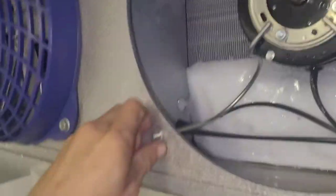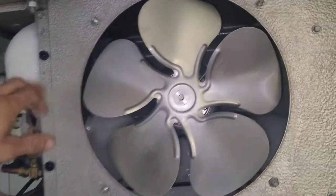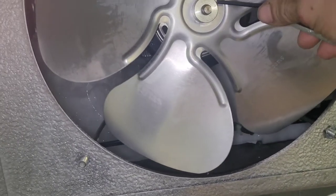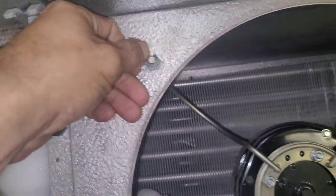To get this out, I'm gonna take the fan out so I can pull it out. I got this fan out — I was able to manipulate that one out, and the one over there out. But there's one back behind the one on the left that's still pretty thick. I'm gonna have to take this one off — take these four nuts out, take the blue fan shroud off, and there are two tiny little nuts that hold this bracket in. And in between those steps, you've got to take a one-eighth inch allen wrench and loosen that — sometimes they're really hard. Then get that big glob of ice out of there. If you don't get all the ice out, it won't work.